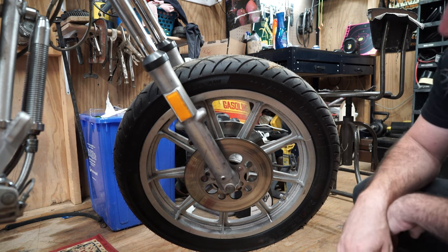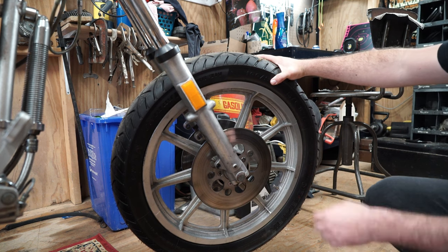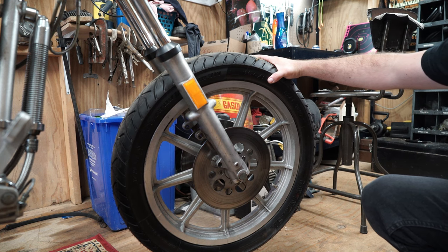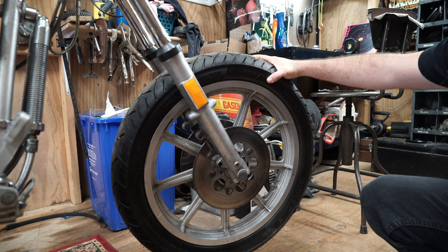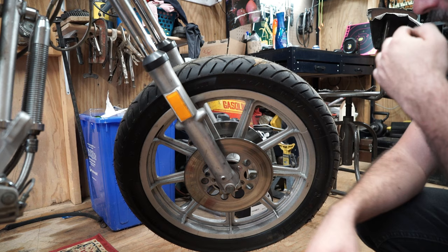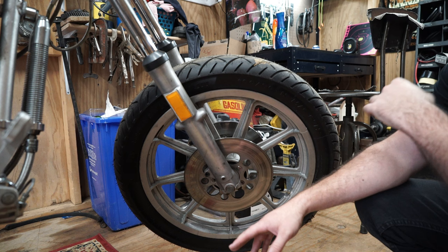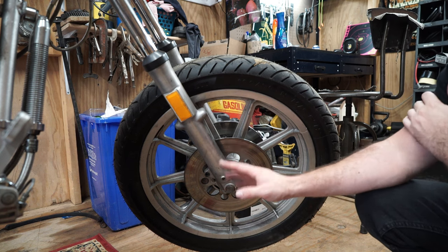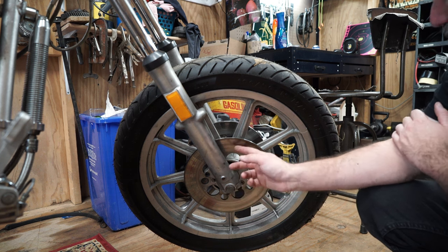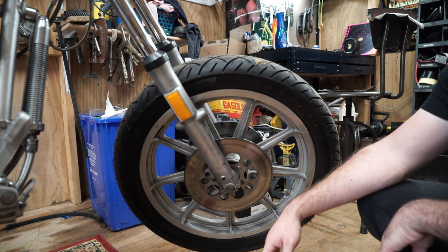That's really not a big deal because you'll also notice we have no front brakes. If you go back to some previous episodes, the master cylinder on this bike was absolutely completely disgusting — it was destroyed inside, the brake fluid was crystallized. I've never seen anything like that. I was going to order two new calipers, but I can't find new ones anywhere, so I ordered a caliper rebuild kit for both front calipers. This bike has dual discs on the front.